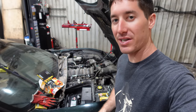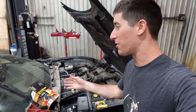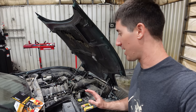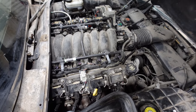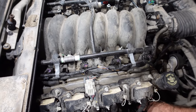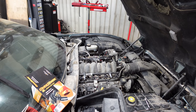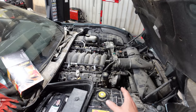The passenger bank of the Corvette is swapped out — all new plugs, all new wires. We're going to start it and I'll hop in to feel if the car is vibrating too much and also try to feel the exhaust manifold to see if any cylinder isn't getting warm. We have to hurry because I don't want to burn my hands. After a quick check — kill it — it's still misfiring. So I guess we keep going; maybe it's a bad coil.